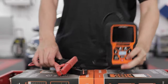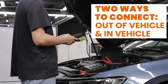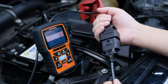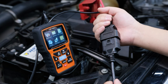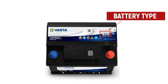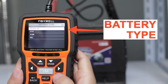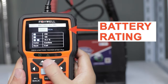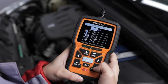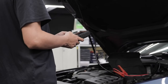To do a battery test there are two ways to connect: out of vehicle and in vehicle. Connecting in the vehicle lets you learn the state of the battery both under no load and loaded, more comprehensively evaluating current battery performance. First, pick what type of battery you have — you may find the battery type and battery rating on every battery. The battery type, battery standard, and battery rating are all important prerequisites for the final test results; if they're not correct, the test result will be meaningless.